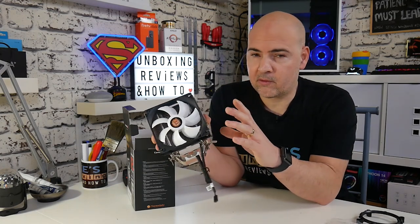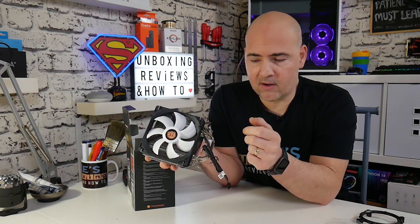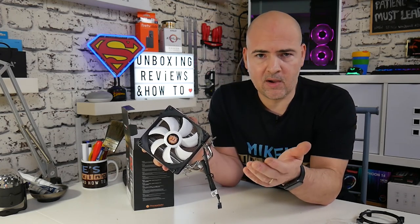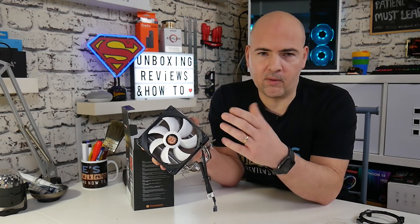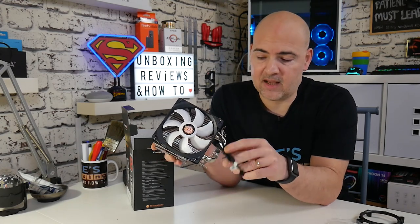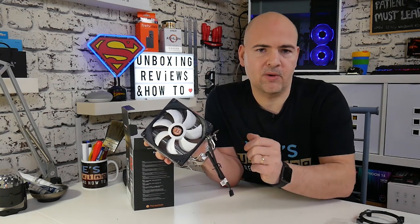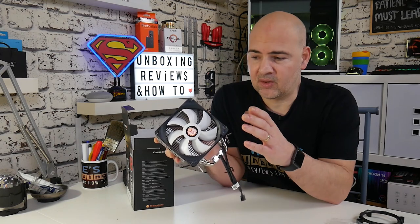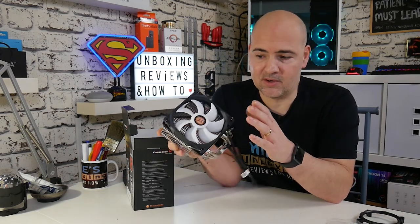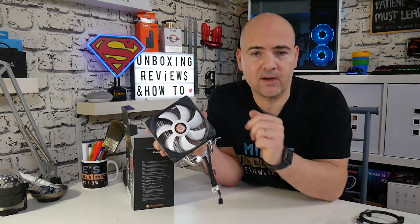For around £20–£22 this is a really good cooler. I've already mounted it on a Ryzen 5 2600 on an MSI motherboard on an open-air platform to test fitment and performance. The ambient temperature in the room was about 24°C, and Windows idle registered around 35–36°C — about 10 degrees over ambient, which is pretty good before any BIOS fan adjustments or using the noise-reducing cable. As for noise, I could barely hear it — the power supply fan nearby was actually noisier than the cooler fan at idle. Full load testing is coming, so hit subscribe to find out how that goes.